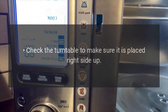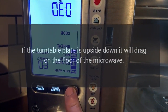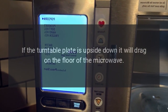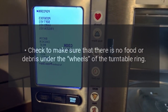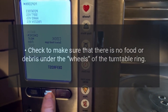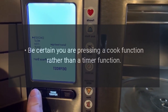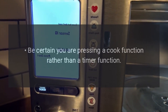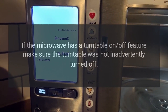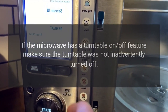Check the turntable to make sure it is placed right side up. If the turntable plate is upside down, it will drag on the floor of the microwave. Check to make sure there is no food or debris under the wheels of the turntable ring, as food can prevent the wheels from moving. Be certain you are pressing a cook function rather than a timer function. If the microwave has a turntable on-off feature, make sure the turntable was not inadvertently turned off.